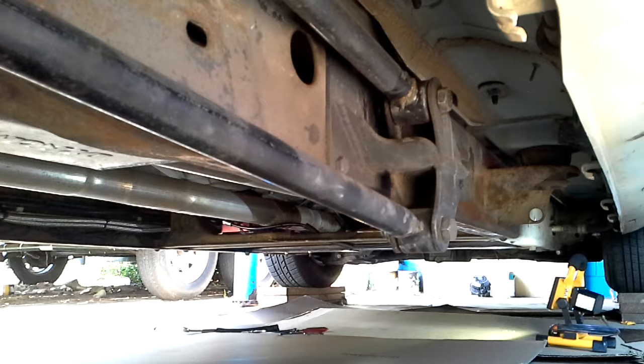I'm going to turn the compressor back on and let it fill up the tank a little bit, then I'll go back with my spray bottle and spray that connector to see if I've got any air leaks. If I don't have any leaks, I'll go back and cover that line with some fuel line, zip tie it back away from the exhaust pipe, and move on to the next project. I'm still waiting on my drive shaft — had to have a new one made — I'll make a video on that once it comes in.